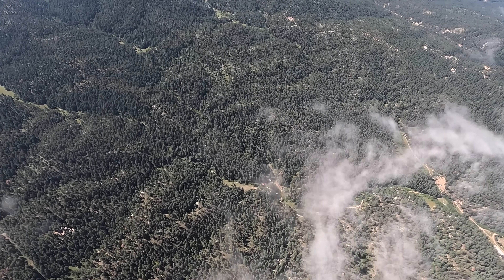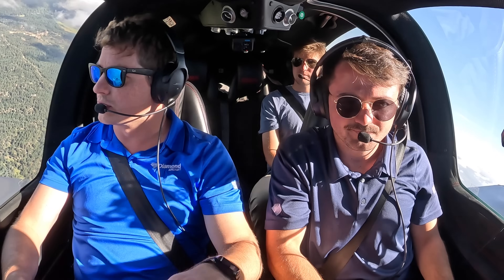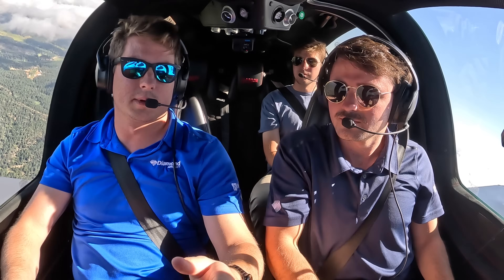I'm going to go ahead and climb us up to about 10,500 feet. I don't have to worry one bit about the engine. In other air-cooled airplanes I'd be leaning them out, redoing my EGTs and CHTs. This one, I just set it for the percentage of power I want to get, and FADEC does everything for me.